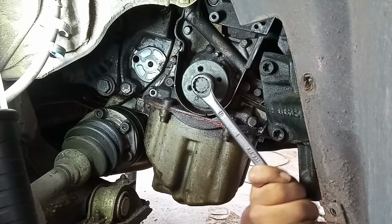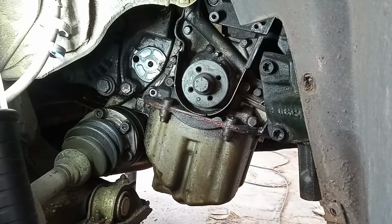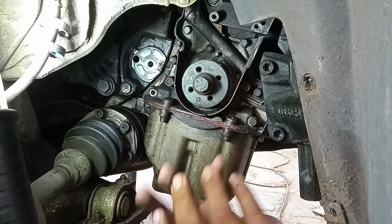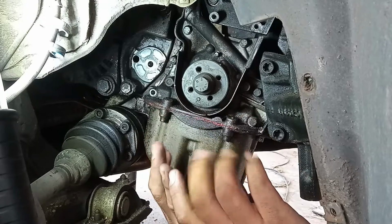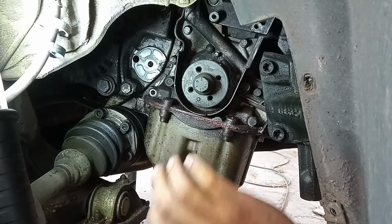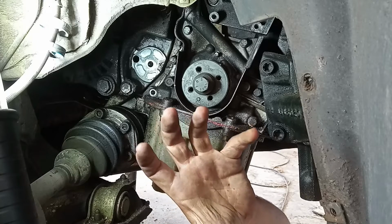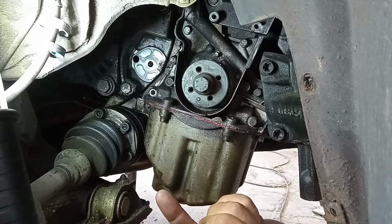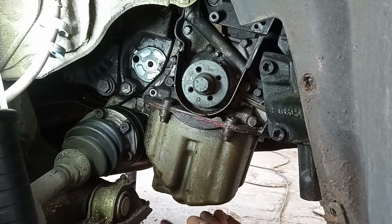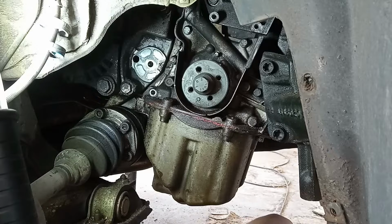Because a few years ago, a friend of mine, my tutor actually, had a problem on a car like this. On the crankshaft itself, you have the target, a dish full of holes where the sensor reads. In this case, I never saw that happen again: the target came loose. I thought until now that, because this car is not reading RPM, maybe the dish is catching on something.